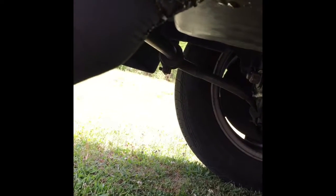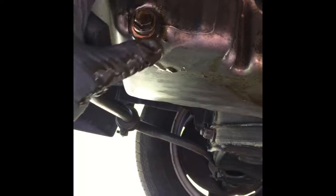All right, so what you're going to need to do real quick is put your oil plug back in. Actually, I dropped mine back in the oil here, but anyway, got that. Put that back on. You can screw that in. It doesn't take very long to do. And then up next, you're going to put in your level sensor. All right, just make sure to clean that area off, so it at least has a clean surface to go into.